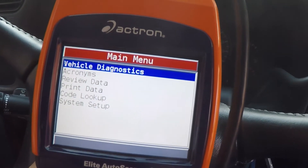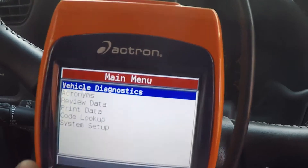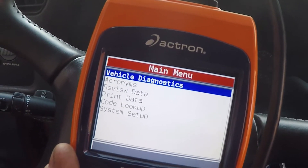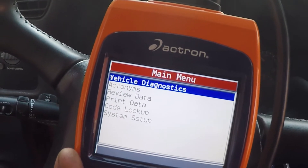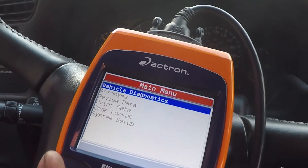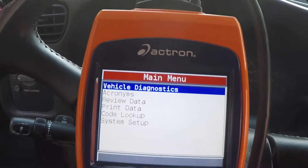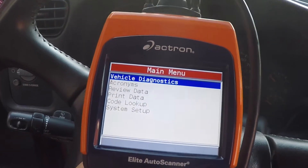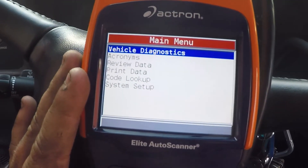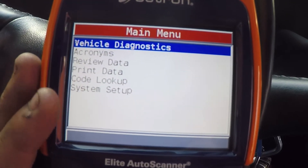How to YouTube. So I'm going to show you a test - you've got to use a scan tool, and it'll help you see if your vehicle is ready for your state emissions test. Now, this does not guarantee you anything; it could also fail even though all these are lit up and working. It's a basic test - it'll show you if your monitors are set.